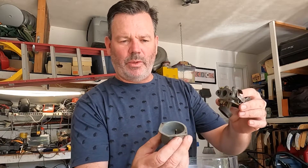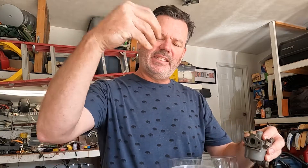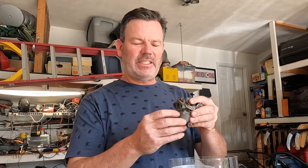They all have a bowl — this bowl here is kind of a gas repository. It's where the gas comes in and it's what the bike uses to run; it has a little reserve in there that it works off of. This glass is going to represent this bowl. When I take it off, what you see is a little float. The float regulates how much gas is in the bowl — it shuts off the gas coming down from the tank when it gets too full, so there's just a reserve of gas in the bowl.